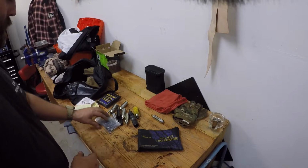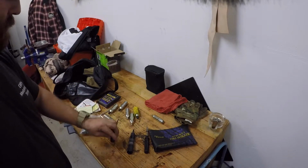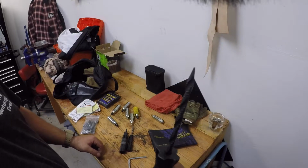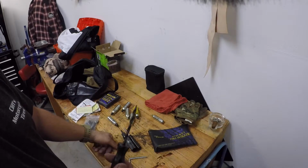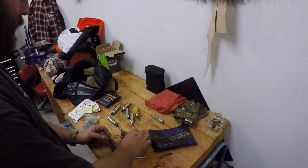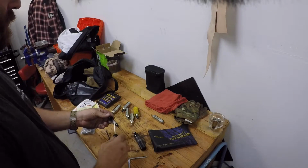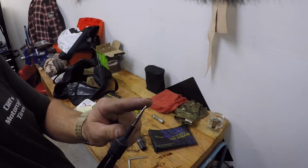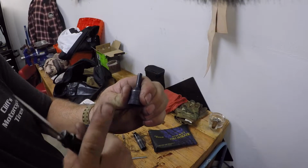And there we go. So basically, these are our tools. You got your reamer. Obviously pull out whatever it is, the object. Now this is only for, like, if you get a nail, staple, something small like that. You have this tool here. This tool here is what you use to install this cone. This goes through into the puncture. It'll feed this in there, then you leave that cone in there, take this out. This will stay inside the tire.